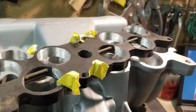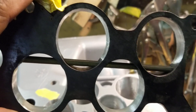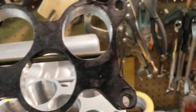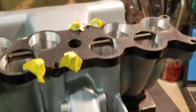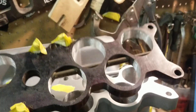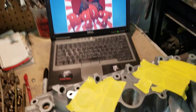I don't like this plate — with the nitrous tubes and the fuel tubes going through the plate, you can see where it's going to restrict the flow when it's naturally aspirated. But this is a nitrous motor, so he's going to be looking to spray a nice shot of nitrous. We did port this plate, so it definitely flows a lot more than the stock plate did.